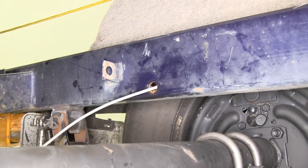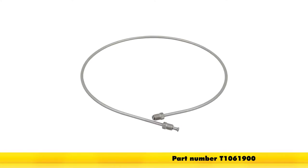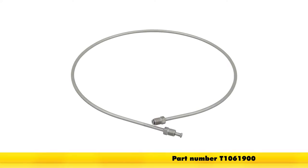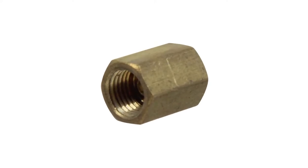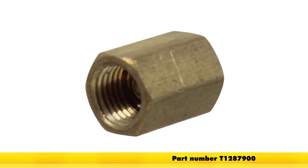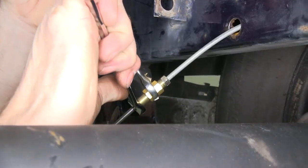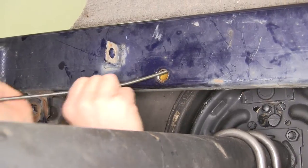In this case, we found out that this length of line is too short. To help extend it, we're going to use part number T1061900 from Titan — a 30-inch length of brake tubing. To connect our first line, we're also going to use a hydraulic brake union, part number T1287900. We'll thread these parts together and tighten them down, then continue pushing the line into the frame.